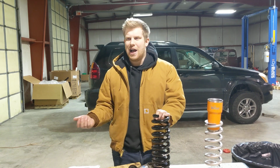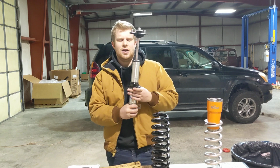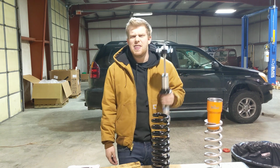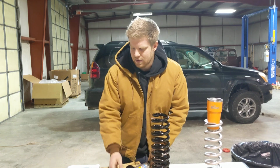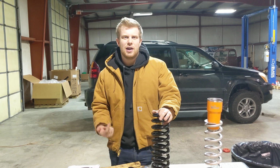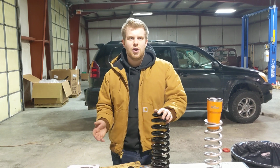Now, one of the questions that get asked almost daily is, customer hits me up and he's like, hey Steve, I have Bilstein 5100s right now, and they're set on the 2-inch lift setting. Great. I saw that your coil springs offer up to 2.5 inches of lift. Can I combine that with my 5100s to get 4.5 inches of lift? Please don't do that. Your ride quality is going to be awful. You're going to have zero down travel. It's going to ride like a brick. That is pushing shocks beyond acceptable limits, and it's just going to be awful for you.